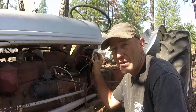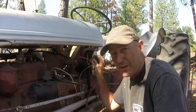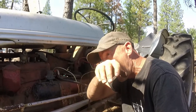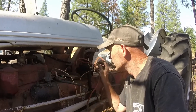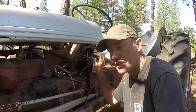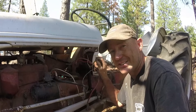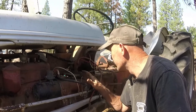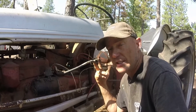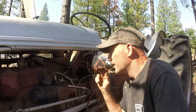These three wires right here behind my head, they're all bolted together — those wires go to the amp meter. I don't have an amp meter that works; it's all broken. So I took it out of the dash so I could go online and find one that was fairly cheap, get one and put it in. But for now, two of these wires go to one side of the amp meter and one wire goes to the other side, just to show how much amperage or voltage is going through your system. I'm going to keep this out of the way and make sure it's not touching anything because it's going to be hot. I'm going to put a battery in here — positive to positive, negative to ground. The six volt system is opposite: positive is ground on a six volt system. So I've got to remember to hook this up correctly.